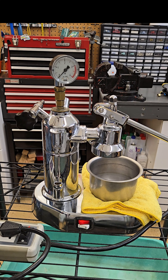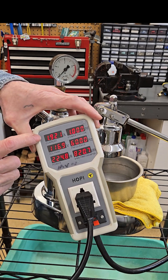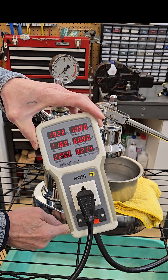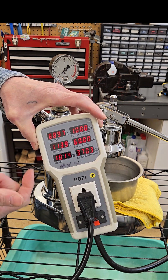The way that the machine works is that you turn the main switch on. On position 1 you will see a small amount of amp draw, then when you turn on 2, that's when the higher wattage heating element kicks in and of course the amperage goes up.